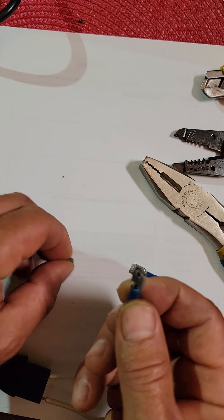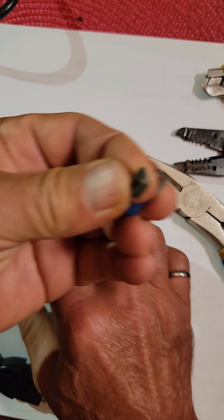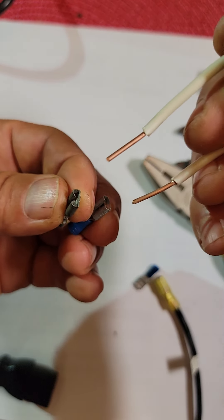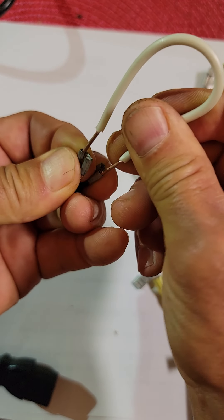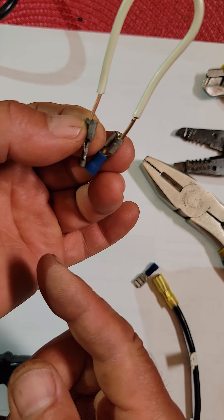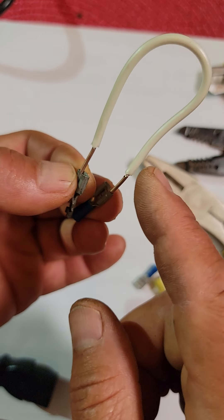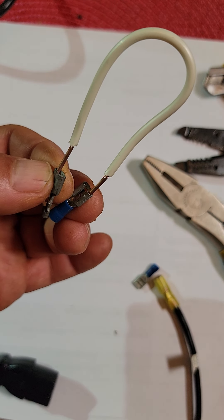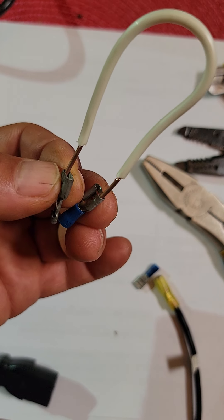This is the concept of jumpering terminals — you're basically running a wire between two prongs to bring power between them. You're getting into one side and the other, closing the circuit. The ignition switch, if it's not working, can be bypassed to double-check it by hardwiring between the two positive leads — that's how you jumper or hotwire across your ignition switch.